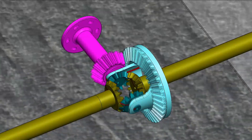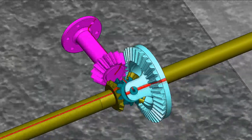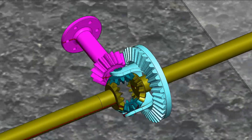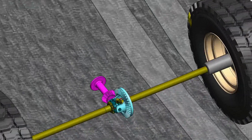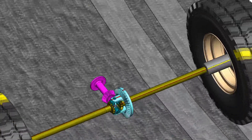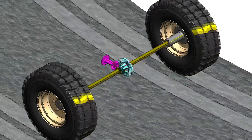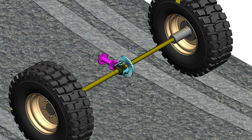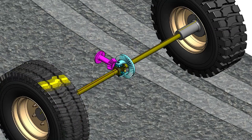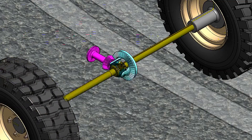Let's take a closer look at the common differentials on the market today, so you will better understand the benefits of a VRD equipped vehicle. The first differential was invented by a watchmaker back in 1827. This ingenious design is still used by the majority of vehicles on the road today. It works great on pavement and anytime both wheels have good grip. Both axles receive torque from the engine and are permitted to rotate at different RPMs. However, there is a problem — torque will take the path of least resistance. The moment one tire is unloaded or leaves the ground, that tire spins out while the other provides no driving force. An open differential provides a 50-50 torque split to both wheels regardless of the situation; the spider gears exert the same torque to both side gears even if one wheel stops.